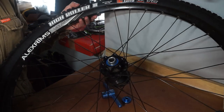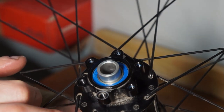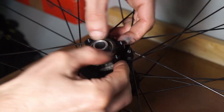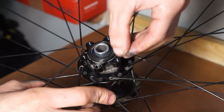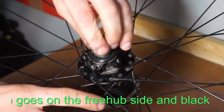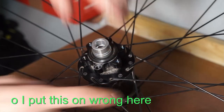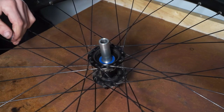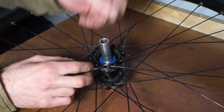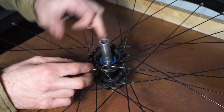Get a close-up to check the bearing — nice smooth bearing in there. Both bearings are now in. Don't forget to put the little rubber seal back on — it just presses into place and sits flush with the edge of the hub. Take the end cap — already pre-greased — and seat that on there. Now install the freehub on the other side. Note the power of editing: I had put the wheel back together and forgot the one millimeter wheel spacer — don't forget to put that in.